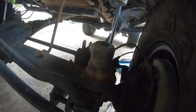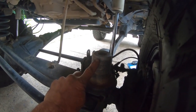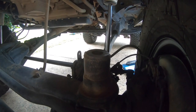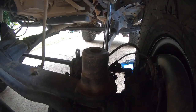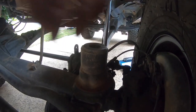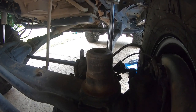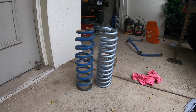The other thing that makes it difficult to get the coil in and out is these bump stops. We made these up — it's basically some billet aluminium that Brian machined up, drilled a hole and put a bolt through. What that bump stop does is limit the up travel so the tires aren't destroying my inner guard, but also at full down travel it stops the coil from wanting to come out of its seat. Even in the comp trucks, we put bump stops in to limit up travel.